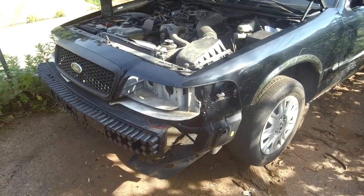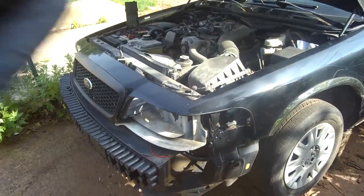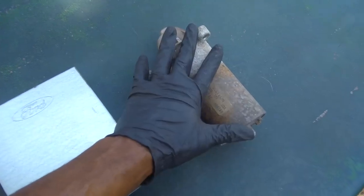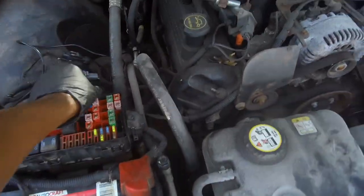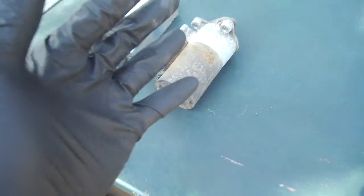This car has not started in about two weeks. I just didn't really do a thorough check as I should. I just threw parts at it and hoped it worked. We changed the starter first — I had a starter situation. I changed it, installed it, that wasn't it. Made a jumper wire, the new starter worked, and also the old starter works.